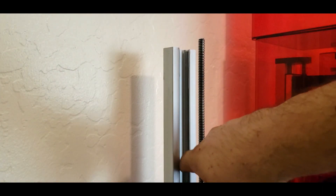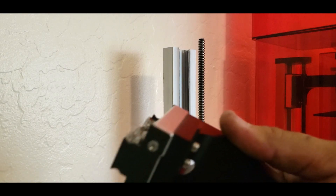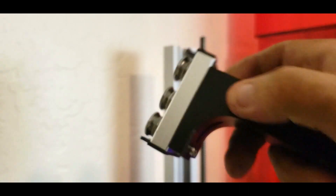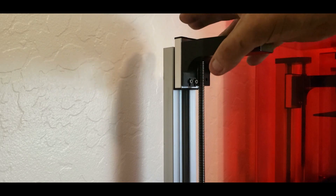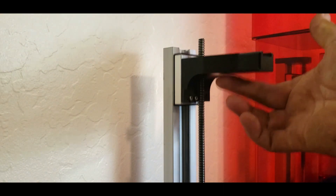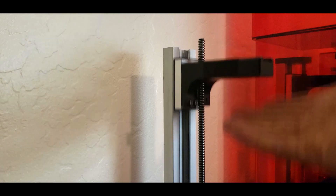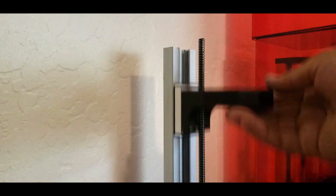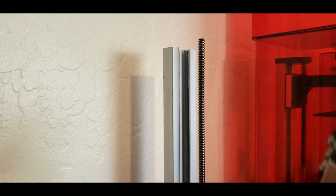If it feels notchy at all, go ahead and wipe down the inner rails with a tissue, clean the bearing rollers, and apply a little grease to the rail system — that will take away any bumpiness, since old grease or oil attracts dust. But this right here is what you're looking for: I can hold it, let it go, and it falls under its own weight straight down to the stop sensor. Smooth, not notchy at all.